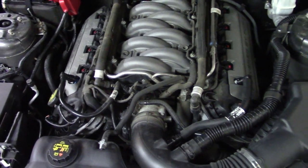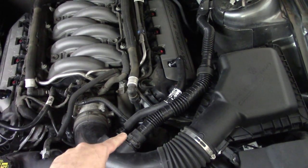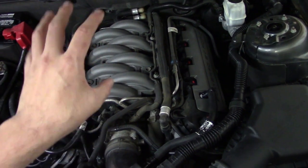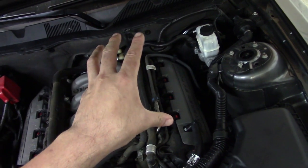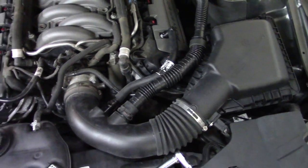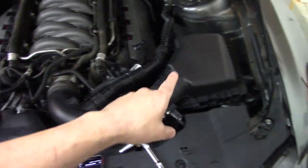So just need to clear off the air intake and then we can get to the rest of the engine. So next thing to take off is the airbox and this, which is called a sound symposer, which on non-modified exhaust systems like mine has the Roush exhaust, so it covers the noise. This pipes intake noise into the cab of the vehicle to make it sound throatier under acceleration. Not a terrible system, it's superfluous. I may block that off since I have Roush exhaust, who cares, right? So we'll see what happens. But next, airbox.